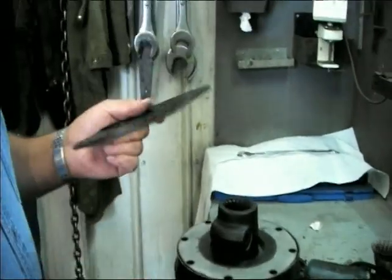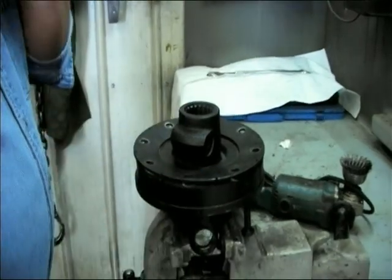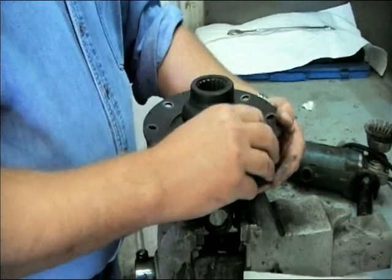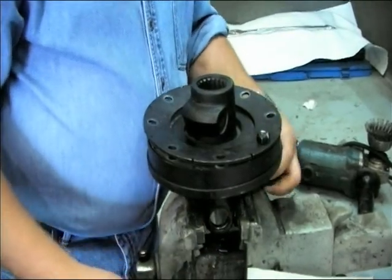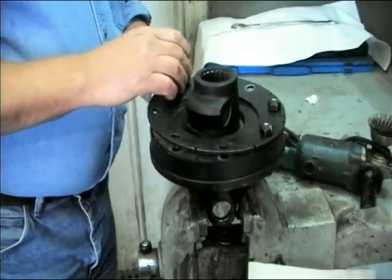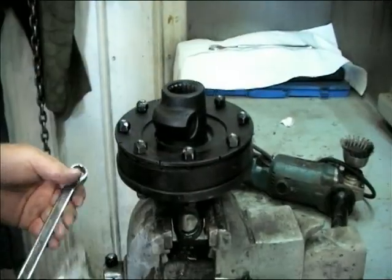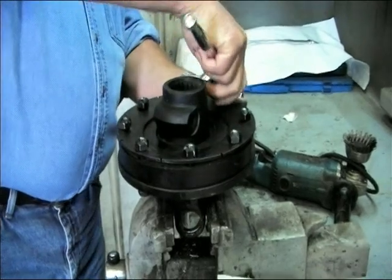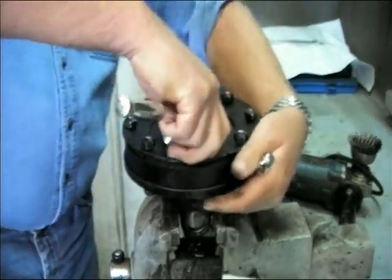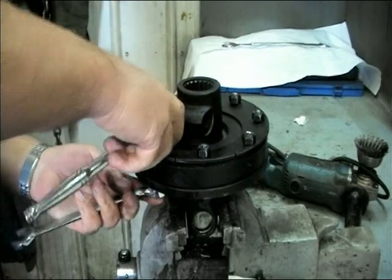Make sure that the inside of the bevel spring makes contact with your compression plate and make sure that it's installed right. When putting it back together, put the bolts in with the nuts to the spring side, put them all in just hand loose at first. You can only start them a little ways because the spring has quite a bevel to it. Once all the bolts are in place, we begin tightening them up evenly all the way around the outside to make sure that the bevel spring doesn't become distorted during this process.